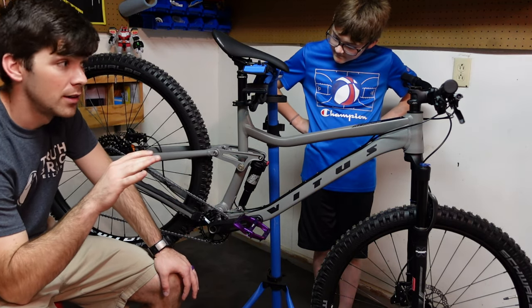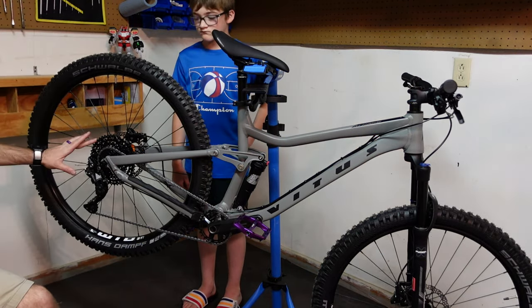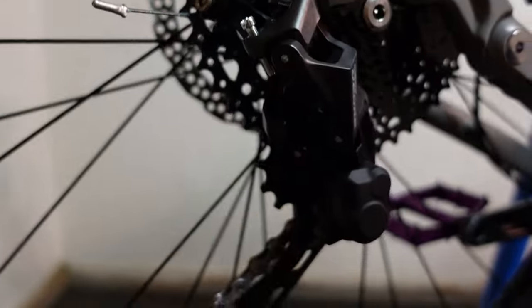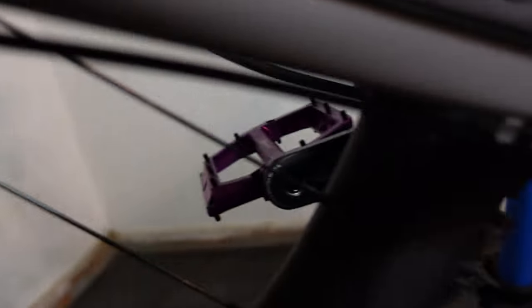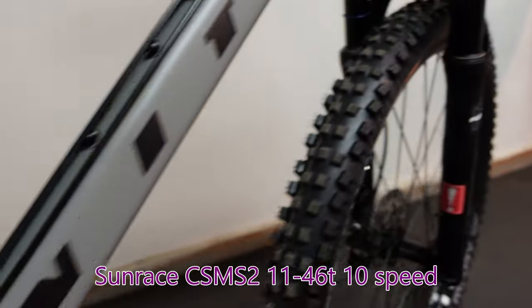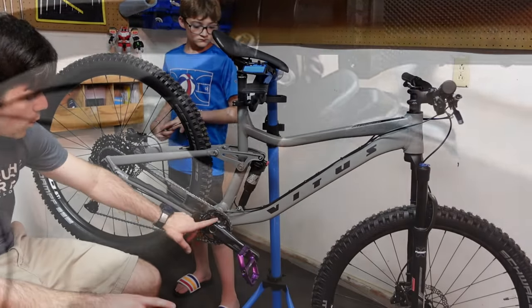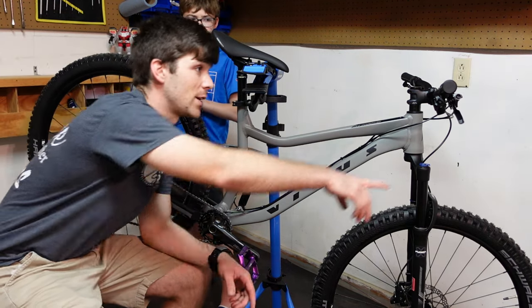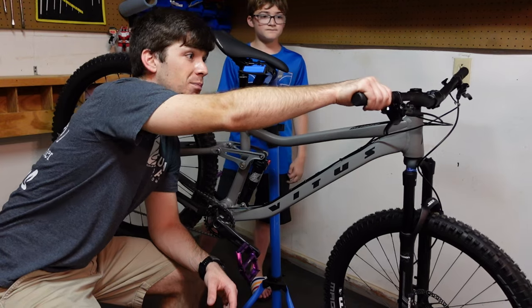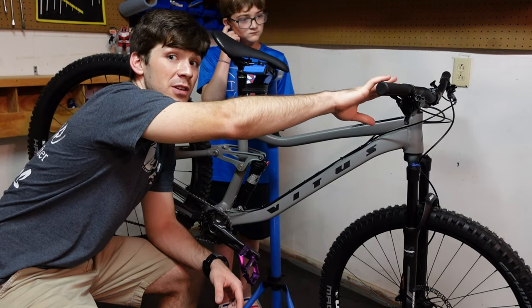The components on this bike are really what set it ahead, in my opinion. You have a 10-speed wide-range cassette — even with a really nice Eagle cassette you get 50 or 52 tooth, so it's not that far off. The black cogset looks really good — I'm pretty sure it's a Sunrace cog. It comes with a Shimano Deore drivetrain: Deore derailleur, Deore crankset, one-by, Deore bottom bracket, and Deore shifter. The shifter is all plastic — and this is going to sound crazy — but I think the Advent X MicroShift shifter does feel better than this Deore shifter, though it shifts perfectly.